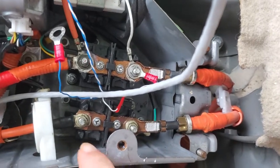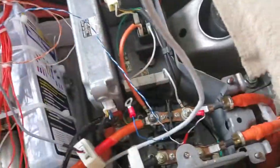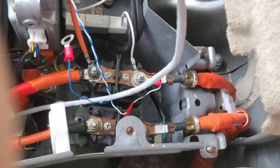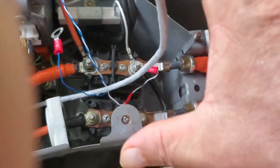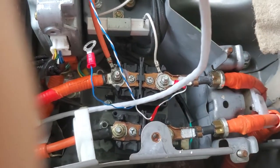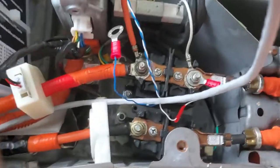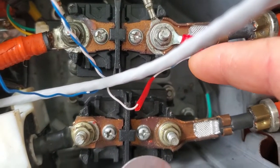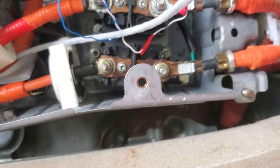So let's get started. Basically, these are all the same nuts. If you don't know how to disassemble this whole thing, I've got a video on how to replace individual cells — I just replaced the whole thing with lithium iron phosphate, so we're good there. But you can do this with just this access panel. There's only a few bolts, and here's the strap that holds these two in. It's easier to remove this because you can raise it up and out of there. So I'm just going to remove this bolt, this bolt, the bolt way down there, and pull the relay out and replace it.